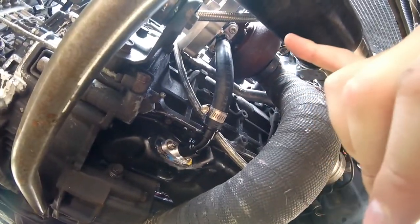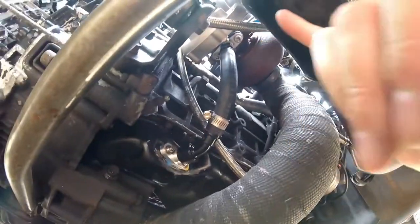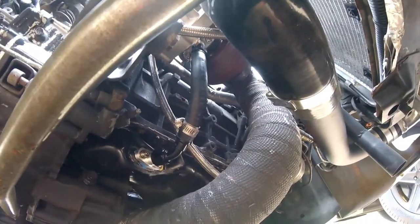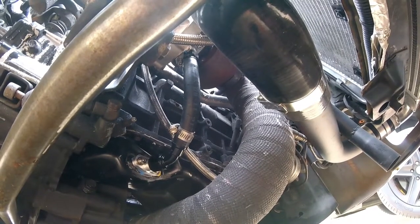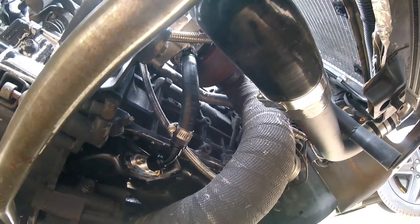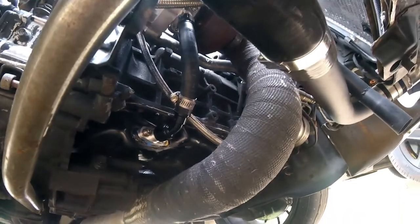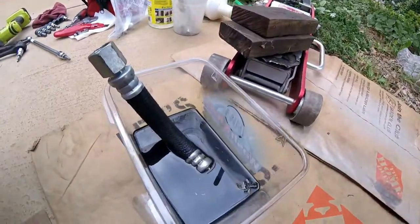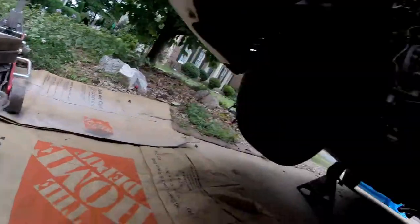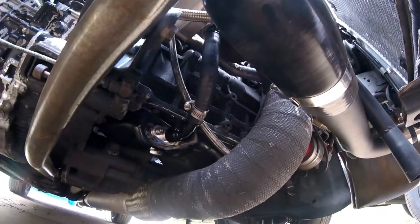Mine took a little bit longer because I ended up having to take the top piece off and redo it because the bolt that holds the turbo compressor housing always gets in the way, so I had to take that off and install that setup first. The Extreme PSI kit is like 60 bucks shipped. You get all the return lines, you get the fittings, you get the adapters for the pan and the turbo, and new bolts. The gaskets are extra but they're like two dollars for everything. That's how you do an oil return line install. This is what my old stuff looked like and that's how much oil came out - I'm hoping this doesn't leak.